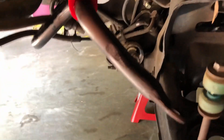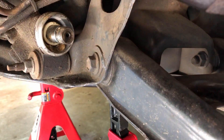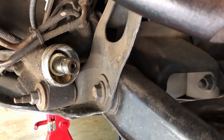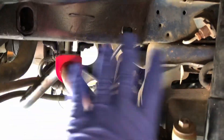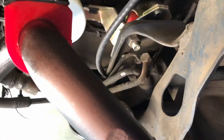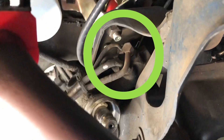I've got the car up in the air to make it a little bit easier. I'm doing a bunch of other projects — you can see the outer and inner tie rods are gone, so I'm going to put the boots back on the steering rack to keep dirt and stuff out. Just above the steering rack, if you take your splash shield out, you can easily see and get to the fittings you'll need to remove to replace those power steering hoses.